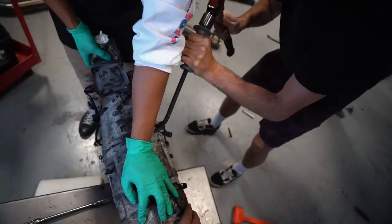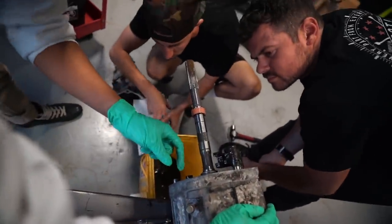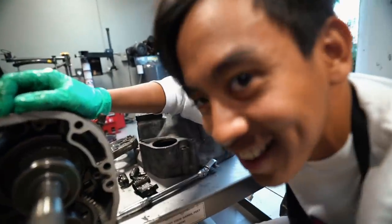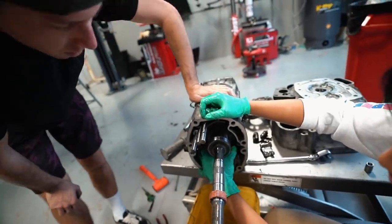We found a new reservoir of fluid and let it drain. There are multiple pieces visible, and we can see fifth gear area — door number five — and it actually looks fine back there. After inspecting the transmission for the last hour or so, we can't find anything substantial. There's a lot of sludge filled with metal shavings, but that's common. The only weird thing we found was the exploded shifter bushing, but even without it the shifter still shifts, so you don't technically need it.